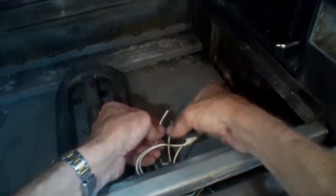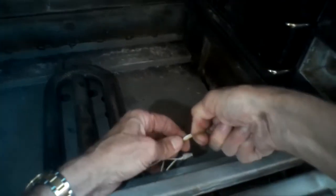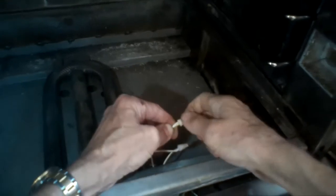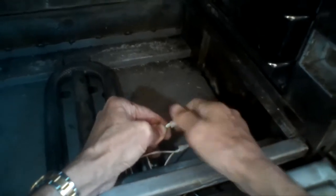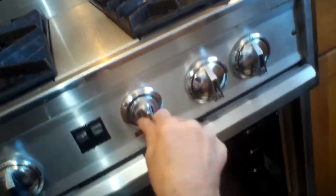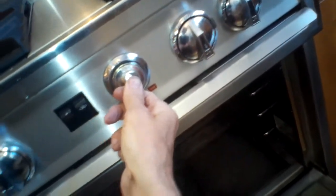There's one — I'll put the other side on. It doesn't matter with alternating current which way you do this. With direct current you have to be more cognizant of polarity, but with alternating current either wire is going to be okay. So we've got those on tight. We're going to tuck those away, put it all back together, and give it a test — and we have good bake function.